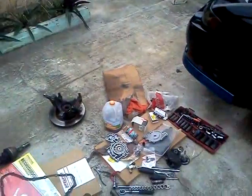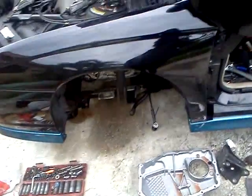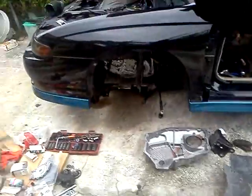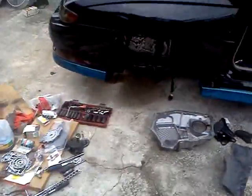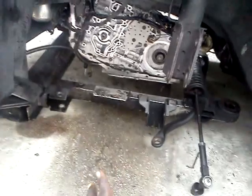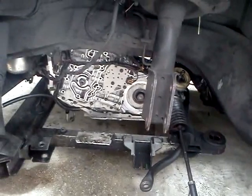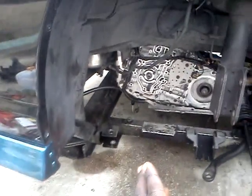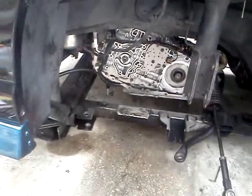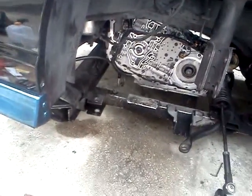These sensors have to be special ordered — I have no idea why — so I waited a whole week with the car sitting like this in the driveway. Today's the day I get to put everything back on. The engine cradle has been taken apart on the driver's side, loosened on the passenger's side, lower control arm, steering knuckle — everything's been taken off. I'm putting out a video of the completed project, and hopefully everything goes on as planned.